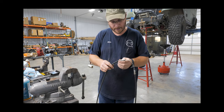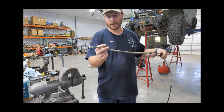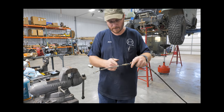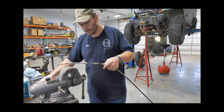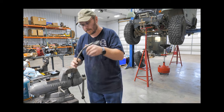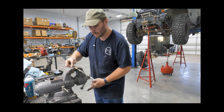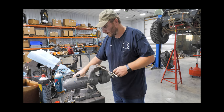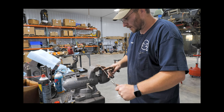The sheath got stuck on the inside of this press-on fitting and I couldn't get it out. I tried pulling on it and it just wrinkled out to the other end, so I thought I'd remove the whole thing. What I did was cut as much off as I could, leaving a couple inches, and I clamped vice grips on it and set it up in the vice — just enough to hold it without pushing it further.